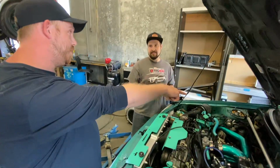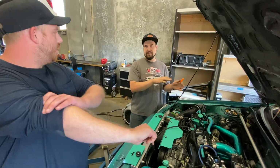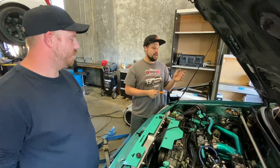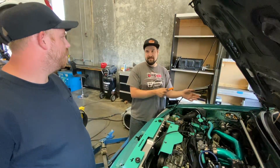It's a WRX. So I would just bypass. Get rid of that controller. And so what you could do is you could just leave the controller there. You don't have to mess with it. You could take it out of your car if you want, but literally just interrupt the power and ground going to the pump out of it. That's all you have to do and go from there.